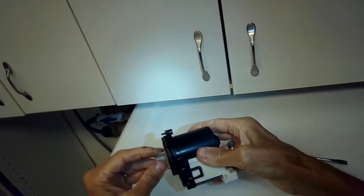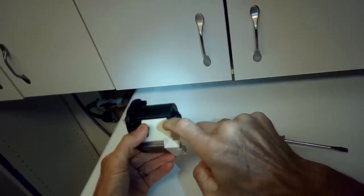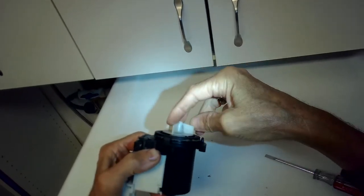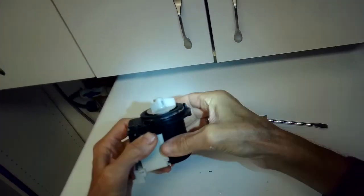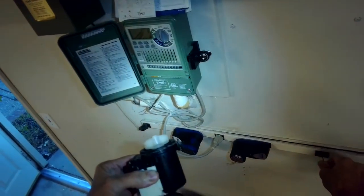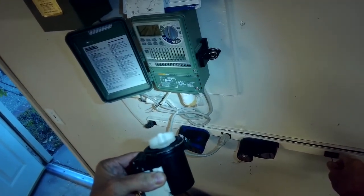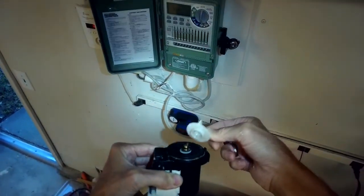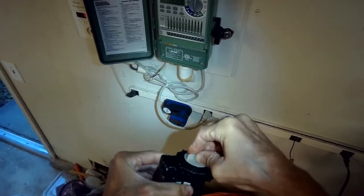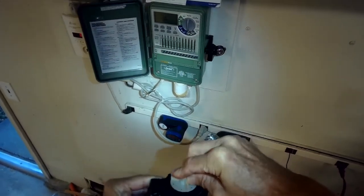a functioning drain again, because the motor works, power's coming in, it will spin. The problem is the shaft spins, but there's no spin of the impeller. See what happens when we add power to it. It'll spin, but it's kind of bouncing around, and that's just because it's still pretty loose, not really on there tight. So even though it's all dirty inside, the motor will still work fine. It's not really the water intrusion that's doing it, but it's just this comes loose from the shaft.